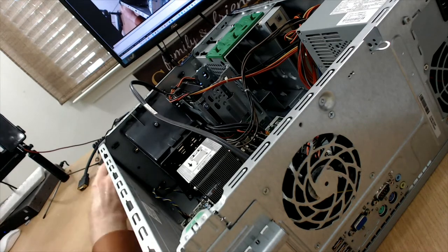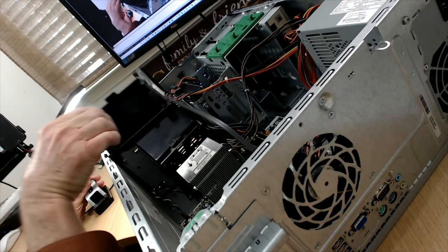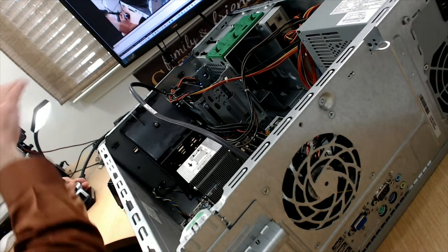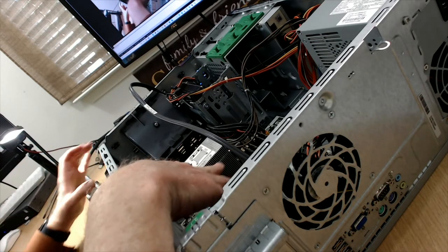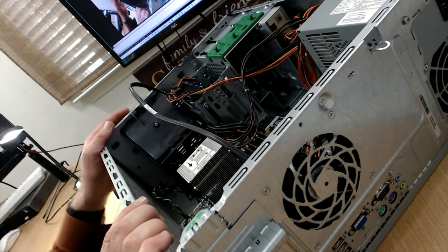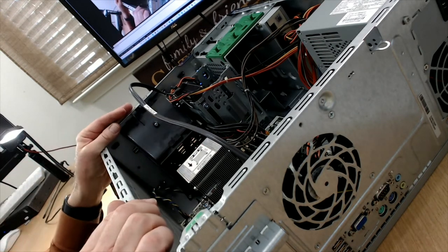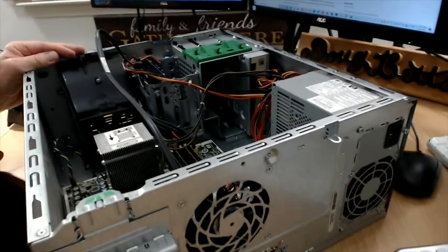And that moist dust that I showed you on the fan shroud is coming from the outside right into this heat sink. So it's easy for the dust in there to be really kind of difficult sometimes to get off. And that's when a can of compressed air is really effective through here. When a blow dryer or vacuum or leaf blower might not be, because of the little straw that a can of compressed air has, is much better. I guess that camera was really wonky, wasn't it?